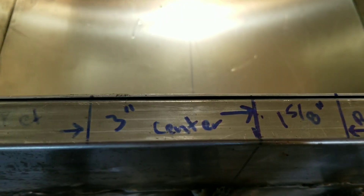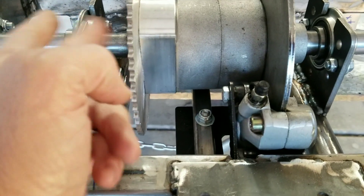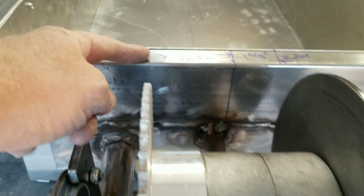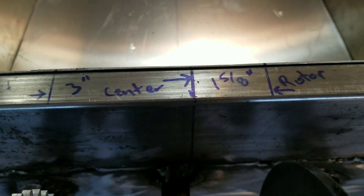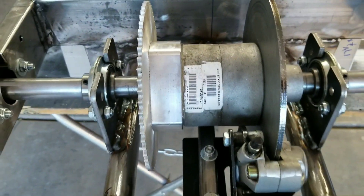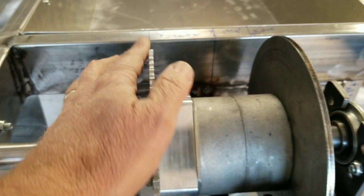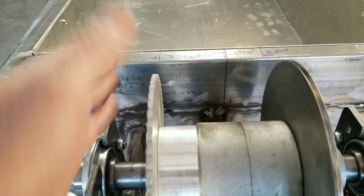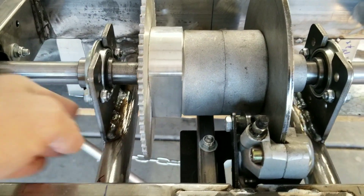When setting up your motor, this Vintage CartCo spacer puts the outside measurement about an inch and a half further out — a total of three inches. You mark your center line: three inches from center is where the sprocket is, and your brake rotor is at about one and five-eighths inches from center. If you're doing a standard solid axle, I measured my other cart and it's only a quarter inch difference. So if you set it up three inches from center and later decide to go to a differential, you won't have to change much — just add some bearing supports. There's a pro tip for you.